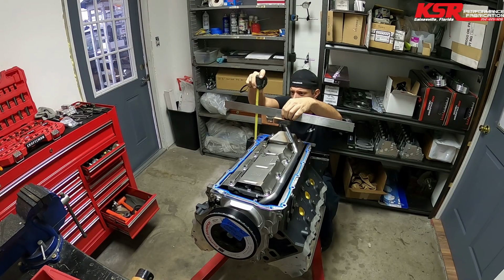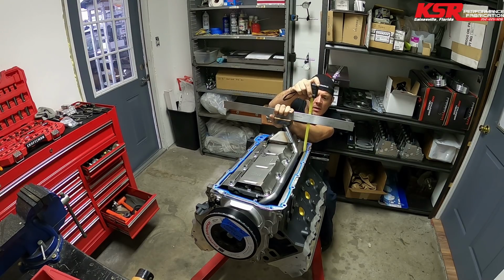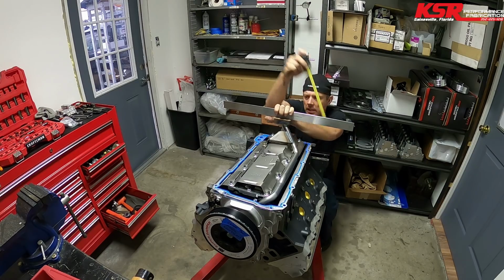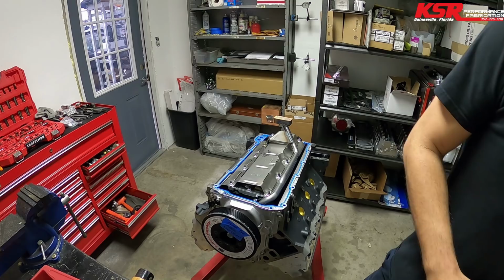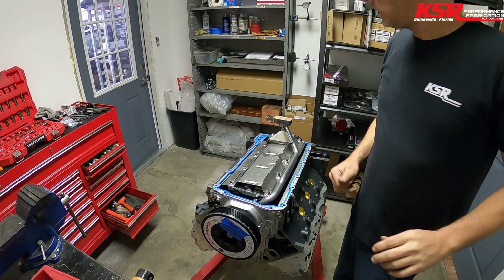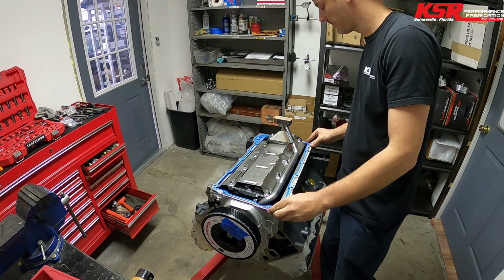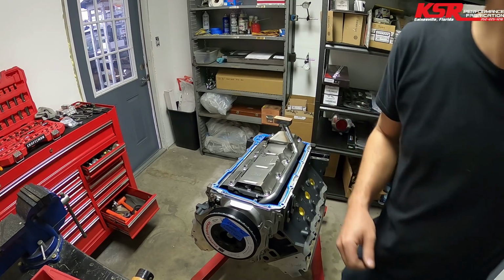All right, 5 and a fuzz under a half. 5 1/2, dead on the money. Oil pan is 5 7/8. That leaves me with the 3/8 that I was after. Math, it's so silly.